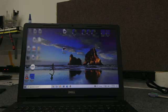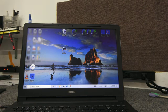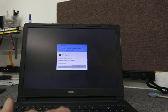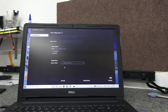Also, disable any running programs — as many as you can that are running in the background down in your system tray. That way you get a better chance of getting a good clean clone. I've already installed the Samsung data migration software. I have a link down below where you can download it. I'm just going to double click it, get the program running, start the clone, then I'll come back when it's almost done. We'll install the new drive and hopefully we'll have a good clone and a much faster computer.